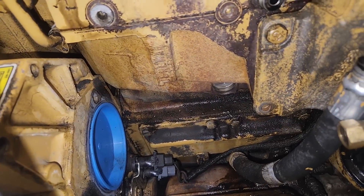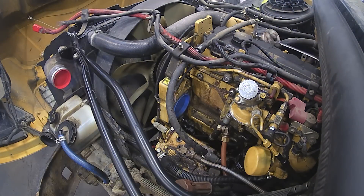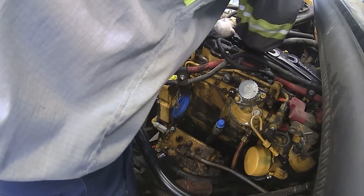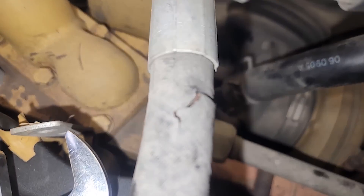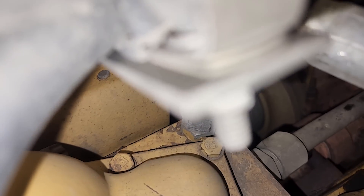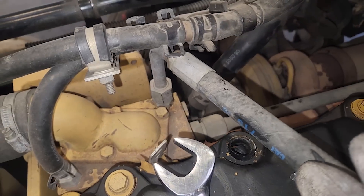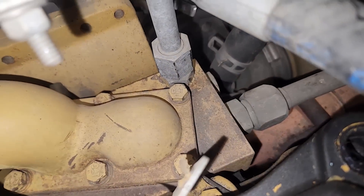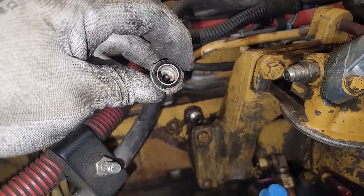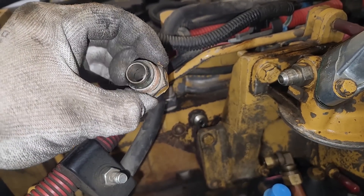Timing sensors are here. Both timing sensors read off the camshaft and have to be replaced as a set, so now is a good time to do them. There's a coolant line that runs over the HEUI pump and the valve cover. I was draining coolant while removing the HEUI pump, but you don't have to pull the line until before you pull the injectors. That line cracked — that's very common. These fittings are really annoying: the fitting on the top side has much larger threads than the one on the bottom, so it spins easily and it's very difficult to get a wrench in to hold the bottom one. It's like an eighth-inch to a half-inch or something — it really destroys your time.